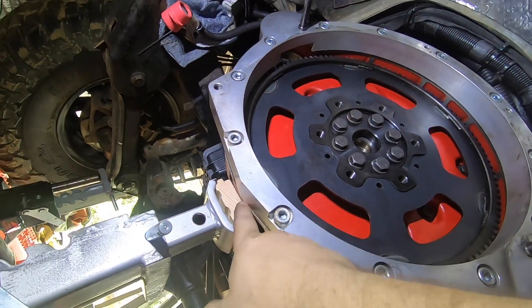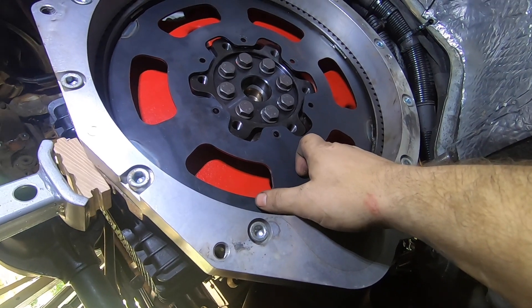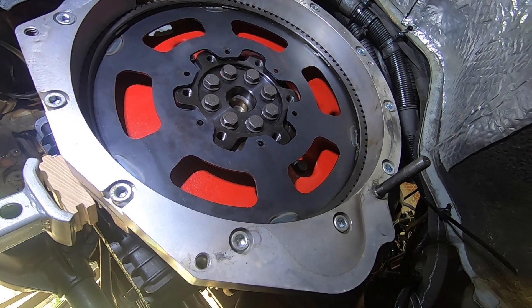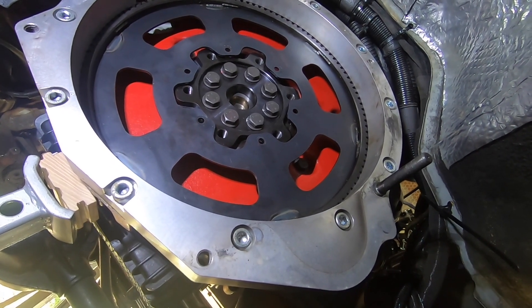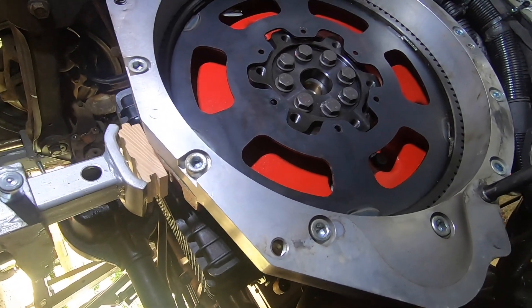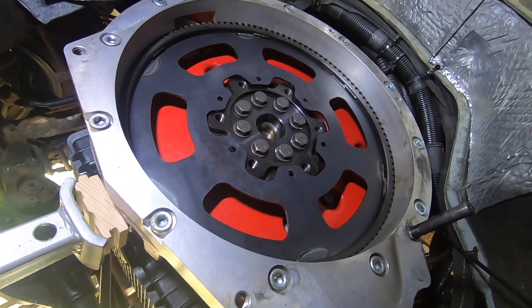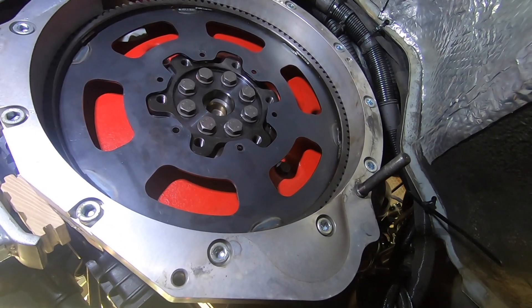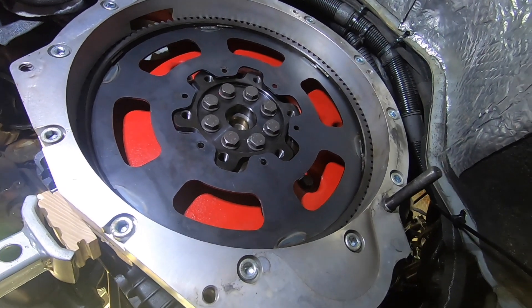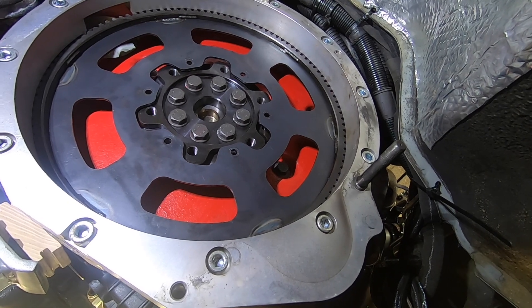I had to readjust down here — I have to take this off; this guy won't slip through. What I did is I actually supported this from the top — I anchored it at the top using just the rear anchor point, then lifted up on that a little bit, let the jack down, and moved it back. Because again I don't want to be jacking on this plastic oil pan. If you spread it out you'll probably be okay since most of this weight is being held by the engine mounts, but I'd rather be safe than sorry. I can already tell the big difference between these welds and the welds on the new one — I'm much more comfortable with the new one.